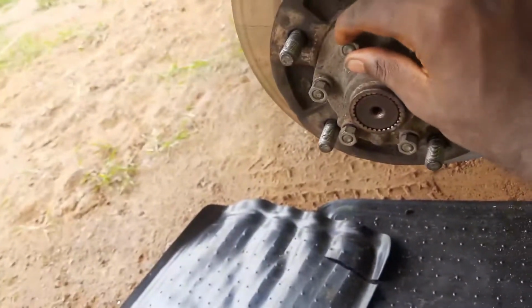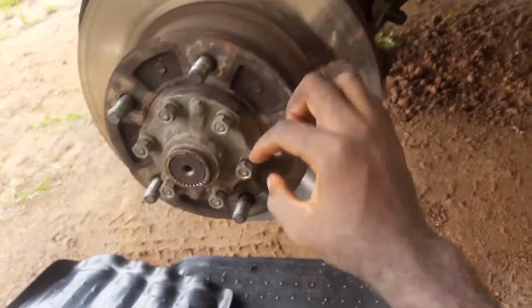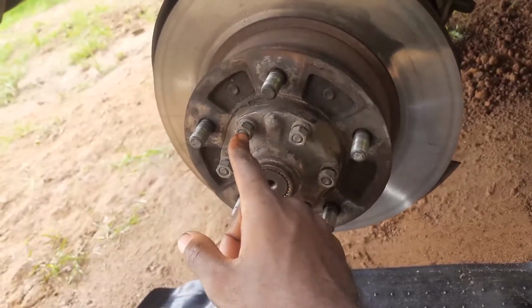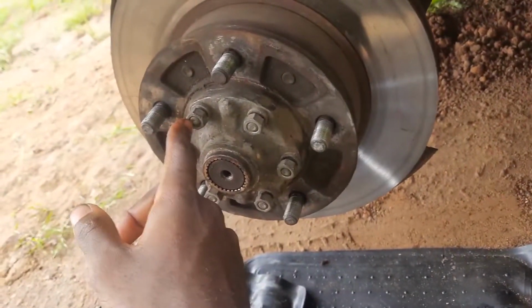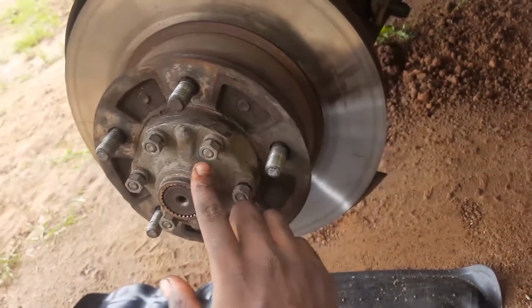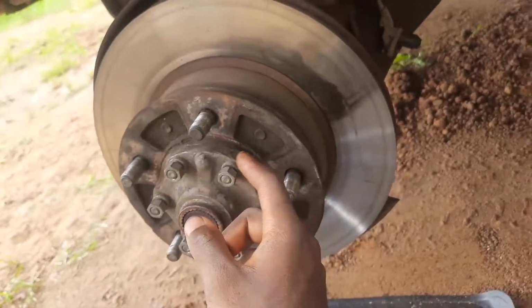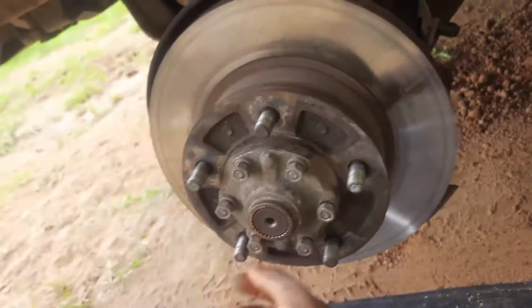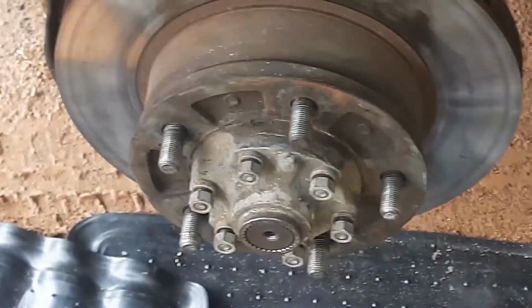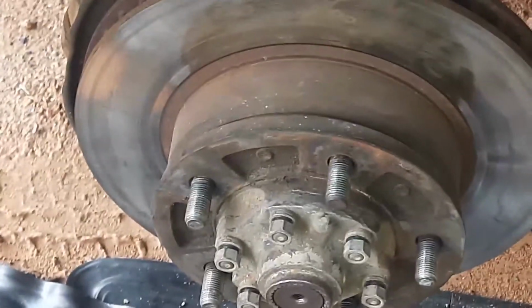What we want to do is first unlock autofocus on the phone, and then be happy that the pump went off. Then we leave these nuts on the end of the bolts like so, and get a rod, preferably a brass rod, something non-destructive but still very sturdy. Place it right on these bolts, then get a hammer and knock that rod so that these cone washers on the inside, which you can't see because they've caked in with the years, will come off. Then we can pull that flange right off and hope the gasket is still intact, or we'll probably have to use some clear silicone sealant and seal that boy up.